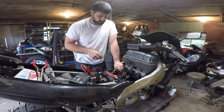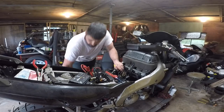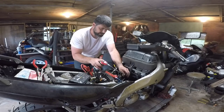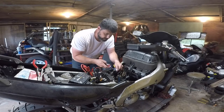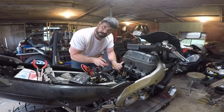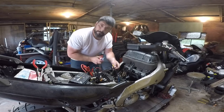Battery went down, so we'll use the jump pad. Figured out why it wasn't working — I wasn't getting gas at the carburetor. What I had to do is spray a little bit of WD-40 into the fuel pump, because the fuel pump was stuck. Old gas got in there and stuck it. The WD-40 lubricates it up, so now we should be able to fire this thing up — back on track.